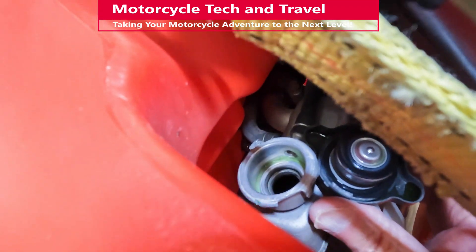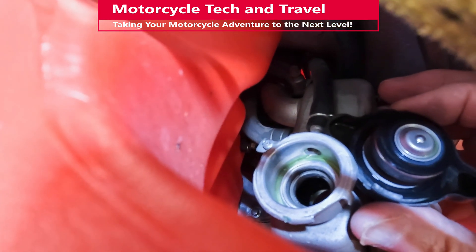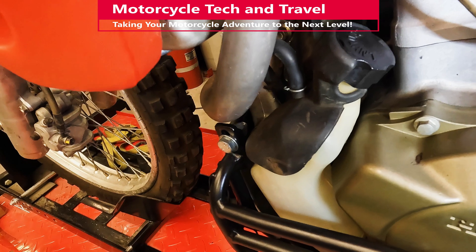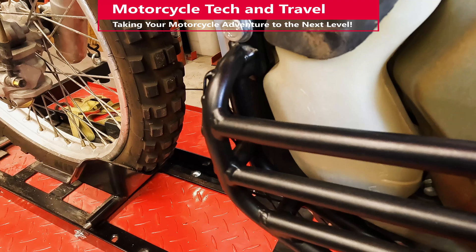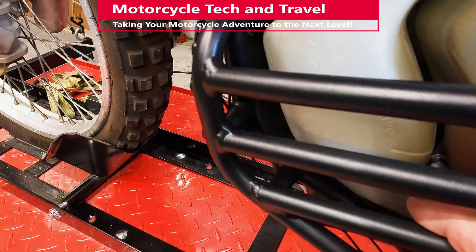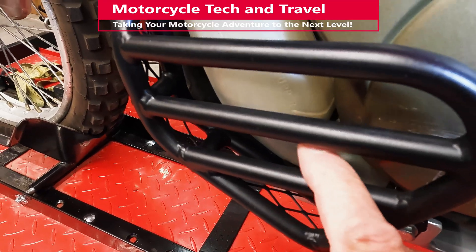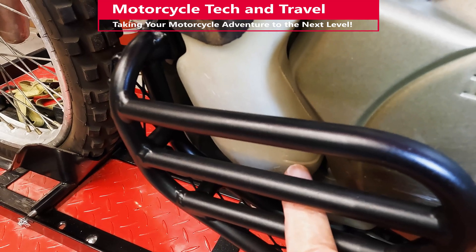The condition of the radiator cap is important. The radiator cap pressure raises the boiling point, seals the cooling system, yet also allows for boilover into the recovery tank. Once the system is sealed, the coolant recovery tank has two marks. The low mark is where coolant should be after the engine cools; the high mark is where it should be when stopped after a long run. As the radiators and engine cool, the coolant contracts, creating a negative pressure that siphons coolant back into the radiators, dropping the level to the low mark.